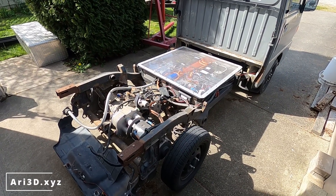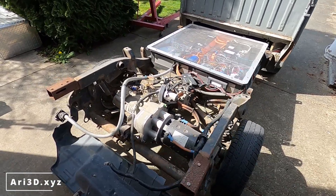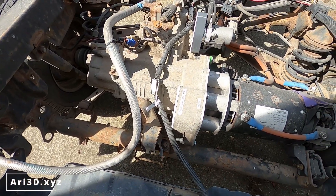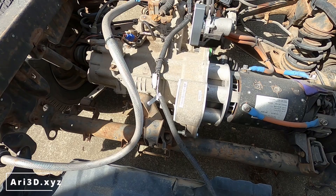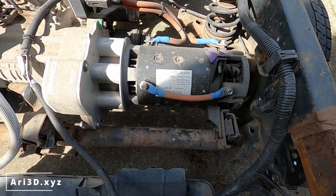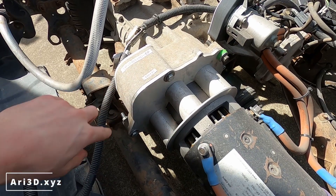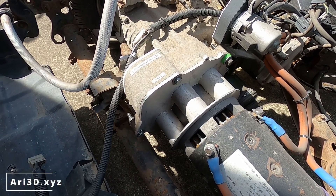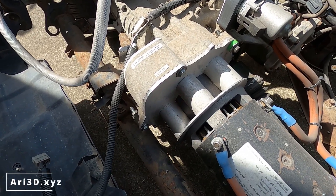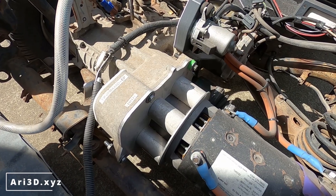So I figured I'd do a little bit of a walkthrough on some of the systems that are under the bed of my truck. Starting out at the back, we've got the original 5-speed with an extra low manual transmission. That hasn't changed since the original vehicle. And then now plugged into it is our 72-volt series-wound DC motor on this custom adapter plate. We've got an adapter plate that matches the transmission housing, some large standoffs, and then an adapter plate that mounts right onto the motor face. Inside there is a coupler that goes from the motor shaft to the flywheel, so the clutch is still being used.